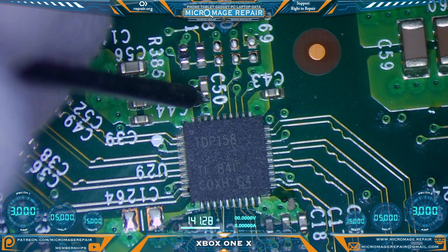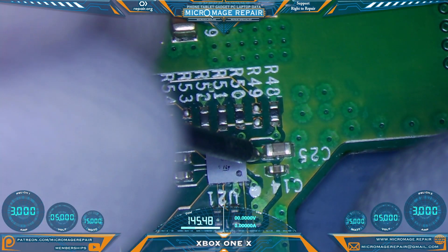Let's see what we're getting — that's a pretty low reading and we should be getting much higher than that. The re-driver has definitely failed and is failing. It should be reading in the thousands of ohms. We're going to change the re-driver.